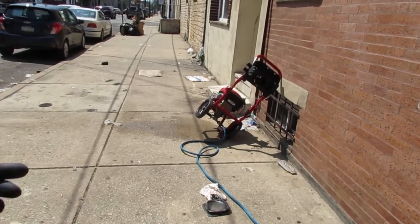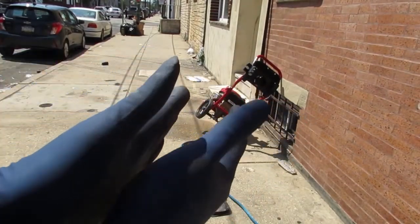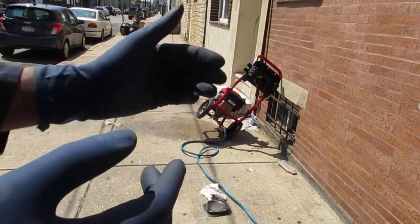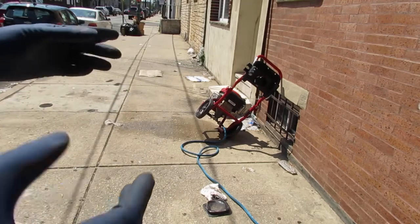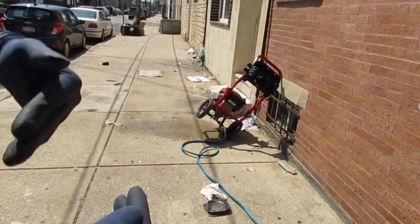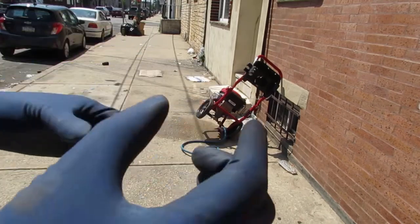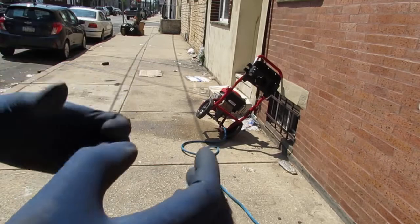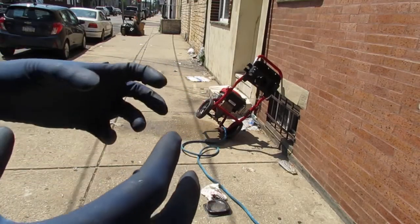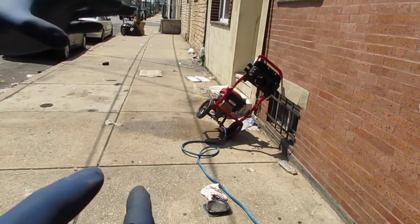Okay, the valve itself will open and close like that, and depending on how much closure it has, it restricts the flow of water. That's what builds up the pressure, because as the water hits the pressure release valve, it circles back. The pump itself is building up more and more pressure, and the little bit of water that gets through comes out at a higher pressure, so you can adjust the pressure itself. So that's what's happening with that.